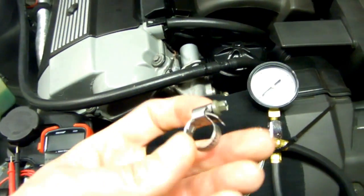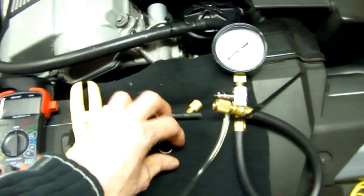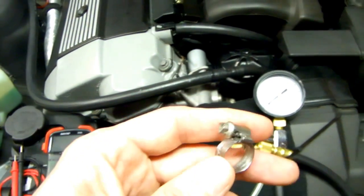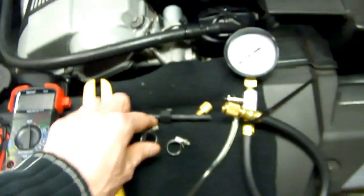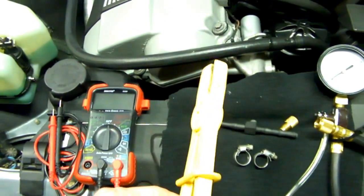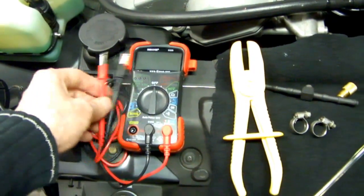You might also need a new hose clamp or at least a couple. These are 10-16mm, which fit the hose just fine. You may run into the factory hose clamps that BMW used on the fuel lines — they only thread in one direction, so they're not really reusable. I also have some hose line pinch pliers to check the pump pressure and check for any bleed-down, and a voltmeter to check the pump power.